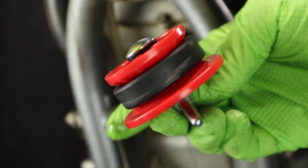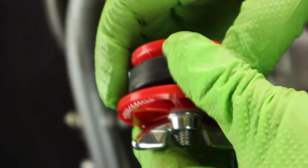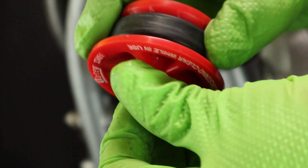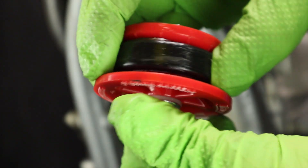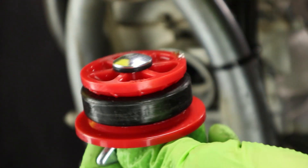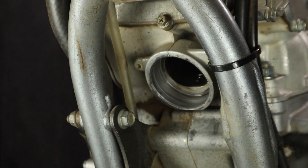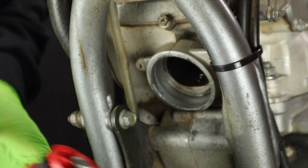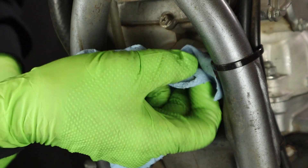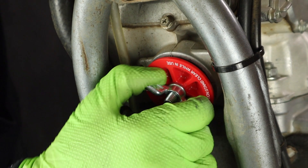The next step will be to pop this bad boy into the exhaust port of the engine. I'm going to throw a little bit of grease on this too — it's probably not necessary but may help with the seal. You can find these in the plumbing and gas section. The grease is a bad idea — don't grease it, it just slides out. Clean that up, hit it with some brake clean. That's nice and tight now and doesn't appear to be able to be pulled out.